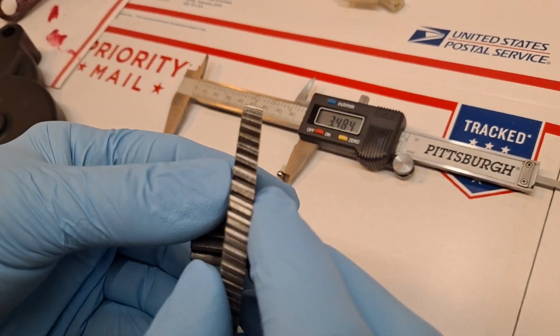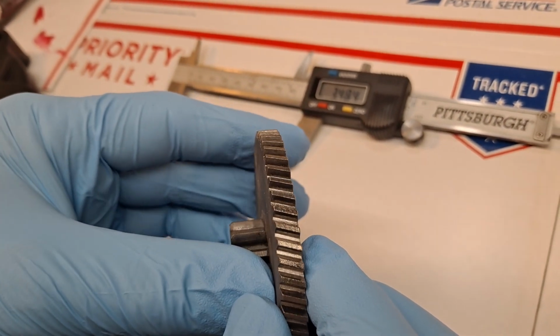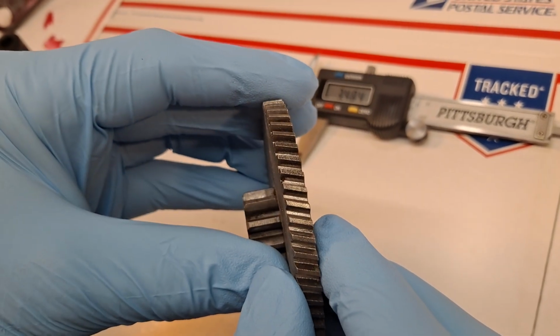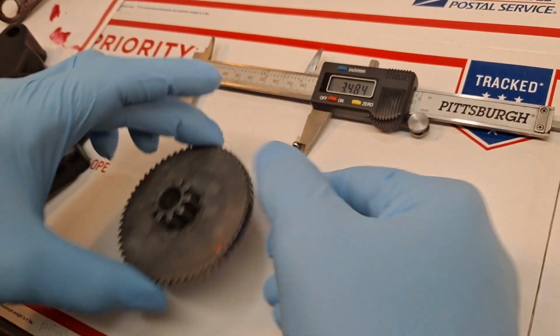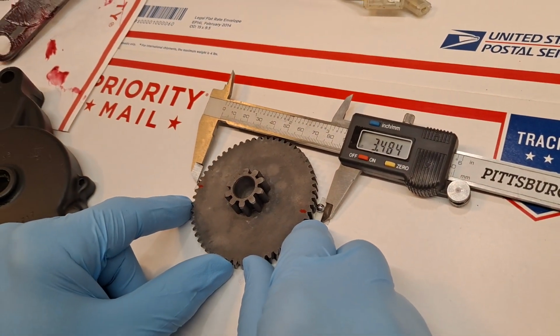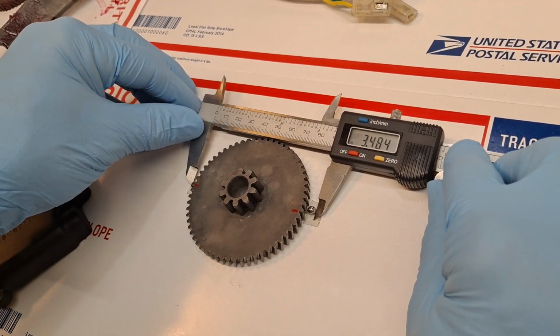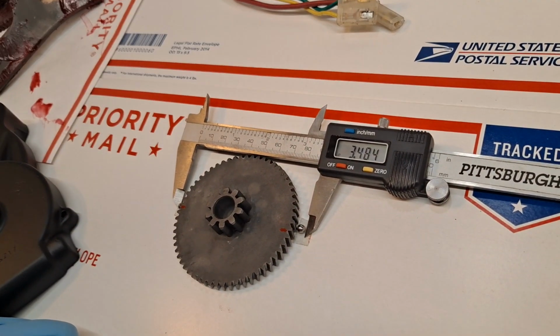And we can see how after the buildup of the diameter, they were put on the Oerlikon machine and the teeth brought back to the original spec. And this provides a substantial increase in torque as we are redelivering the original dimensional integrity from the gears that have become worn out over the years.